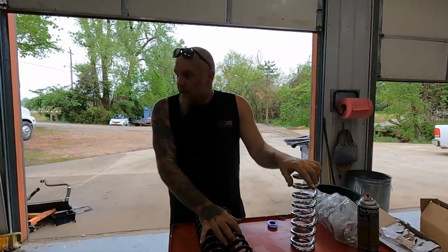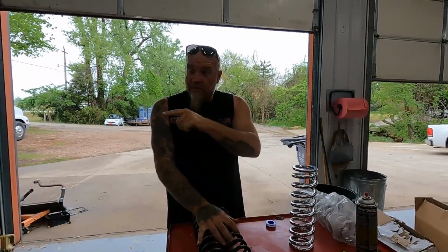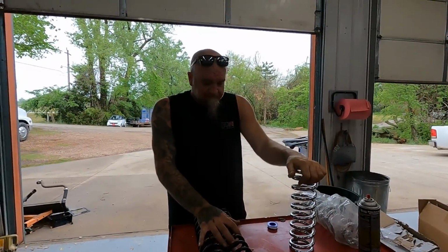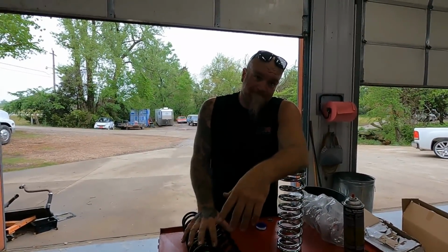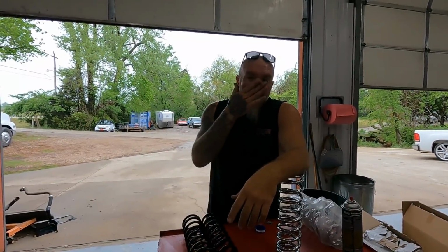But it could just collapse the front. And if so, I'm gonna have to split the difference between the 325s and go 275-ish. Not real sure, but we're gonna do that, and we've had a couple of leaks on the transmission. We have got to put a diaper on the car today, and we also have to pull the transmission, and it's stupid, but we have to pull the whole transmission out just to fix a fitting that we believe is broke. So dumb. But one little 1/4 inch fitting.